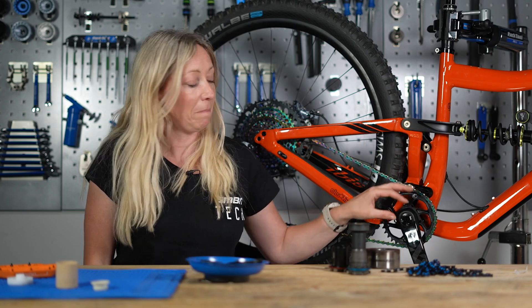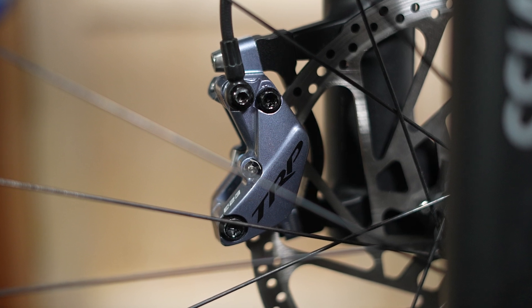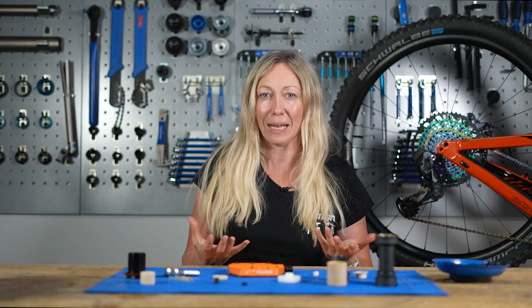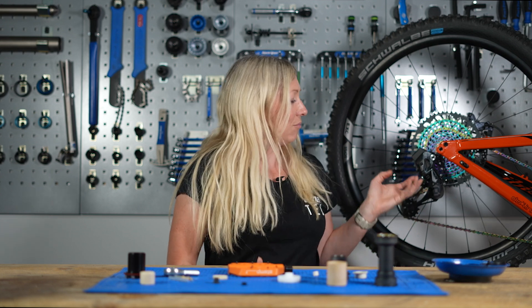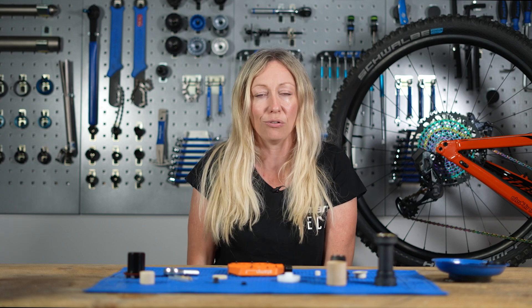The bushing will last a lot longer. Equally, you may not be able to swap out bushings or bearings in things like your derailleurs or brakes. But if you find these things wear out quite quickly — perhaps your levers get baggy or the body of the derailleur needs replacing and you're purchasing entire units — then maybe you want to start thinking about moving over to brands that use high-end bushings like igus in the future, because it might actually save you money in the long run.